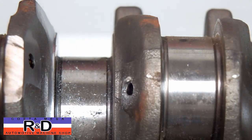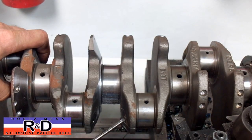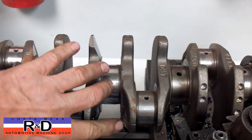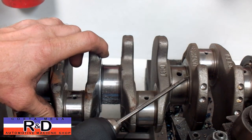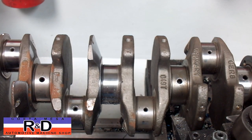And there we are. So we went from here all the way down to this hole in the main, and it's a larger hole, so any chips that we've got that have come out from our drilling process are going to come out of here. You always want to drill all the way through to make sure you get everything cleaned out. Anyway, this is just one of the ways you can take and get the steel balls out of your crank. If you have any questions, you can call us. We'll see you soon.